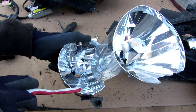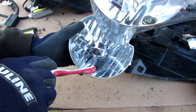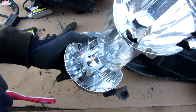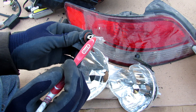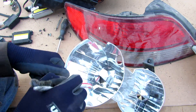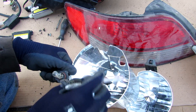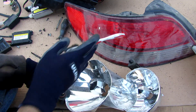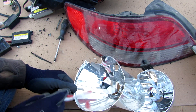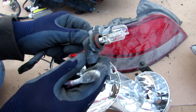In some vehicles you'd integrate both the high beam and the low beam into one reflector, and in those reflectors you might see a lot of smaller sections — some optimized for the low beam and some for the high beam. Now because light bulbs don't effectively emit light out the front, they mostly emit light around the outsides. What these bulb caps do is capture all of that light and spread it evenly across the reflector, so most of that energy is focused going to the reflector and not wasted going straight out like a tail light. Tail lights have much lower illumination, so an extensive reflector design isn't really required.